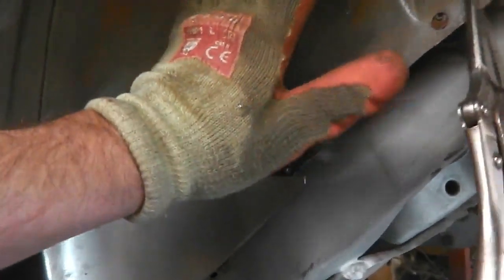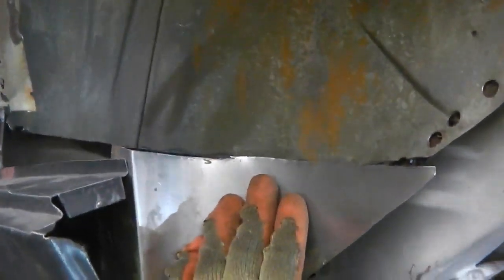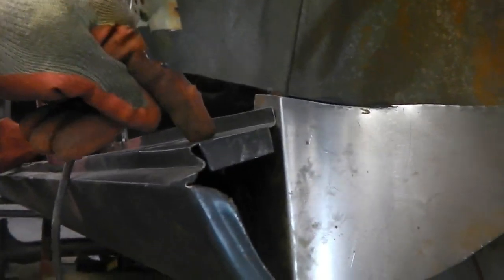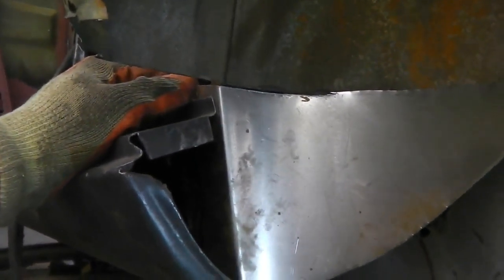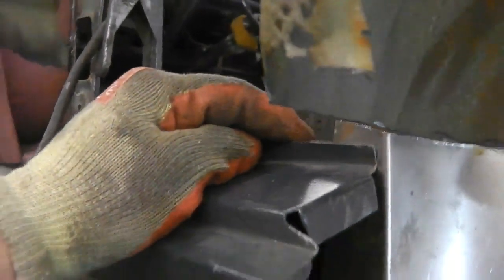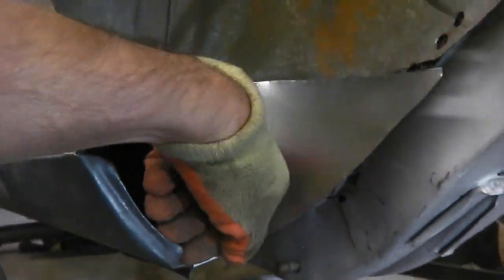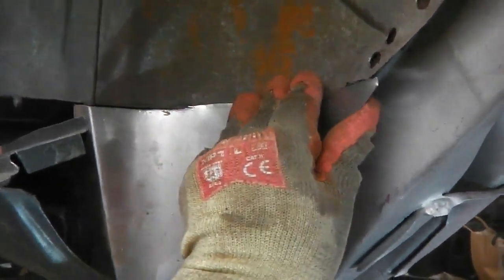So really effectively, the damage on the inner housing in this, what looked like could have been a tricky repair, is actually really easy. If you can open up the gap between your outer sill and your inner sill. Now you might be doing your own restoration and you've not got that far yet, but if you can split them apart, it just means that it makes for a better fit, because this grabs in and you can tap in and it grips it. And if you've cut your template right, we're nearly in there with our template.